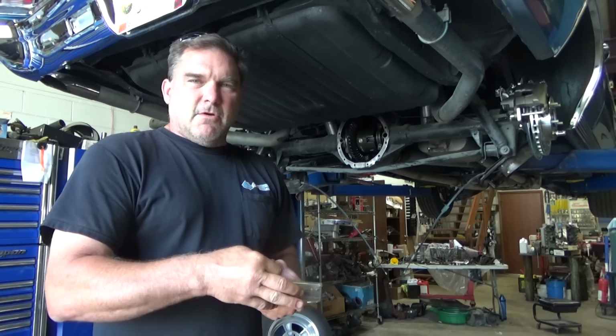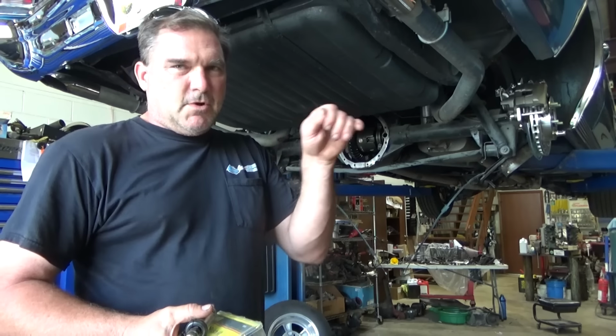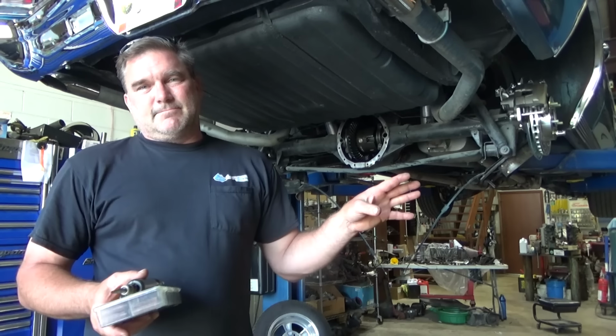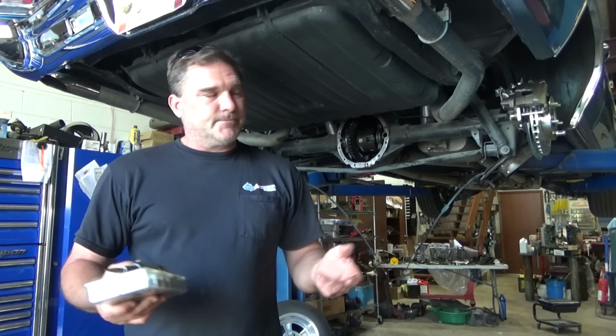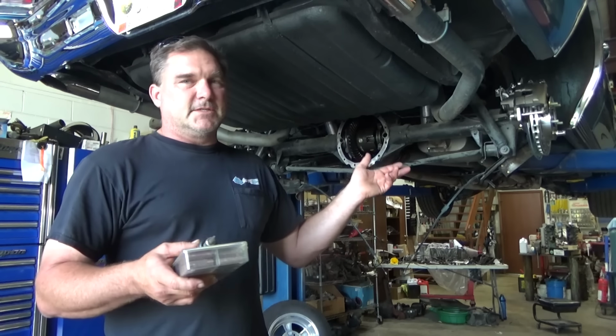But if you're at home and you're doing this, basically you're just going to ream out the inside of the rotor until it fits the axle. And that's probably why they suggest in the directions to check your fitment before you go all in on it. So it's just one of those things you need to look out for when you are doing custom stuff.